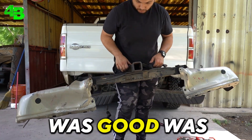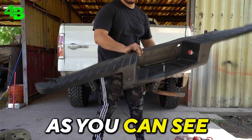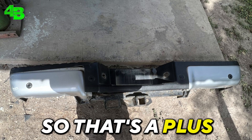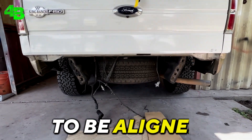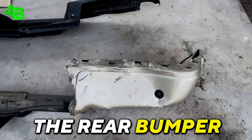Once the bumper was removed, we noticed right away it was no good to reuse or salvage parts — the only thing that was good was the hitch. After setting aside the bumper, we went ahead and removed the bumper cover, slowly trying not to damage any wires connected to it. The bumper cover looks to be damaged and cracked, so we would have to replace it — but luckily the bumper we bought came with sensors and the bumper cover. We then checked the frame to see if it needed to be aligned so the new bumper could fit into place, and by the looks of it, it is not damaged.